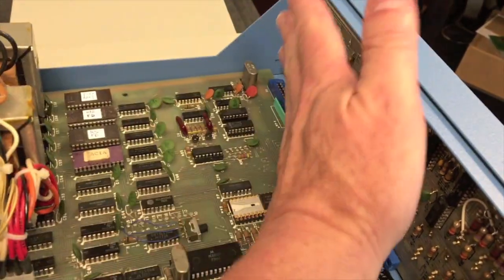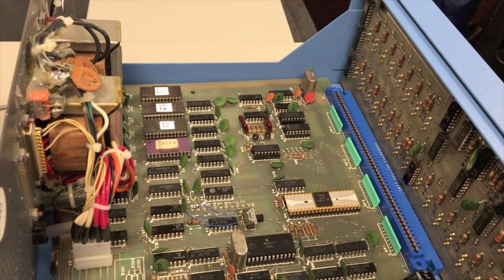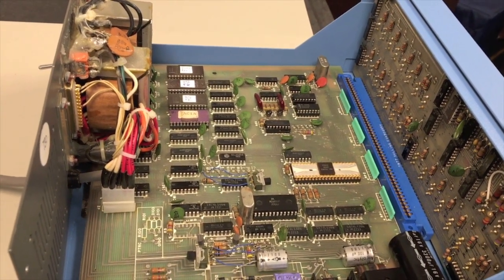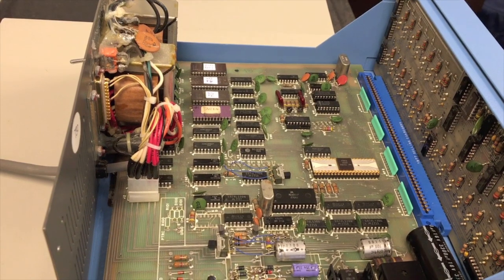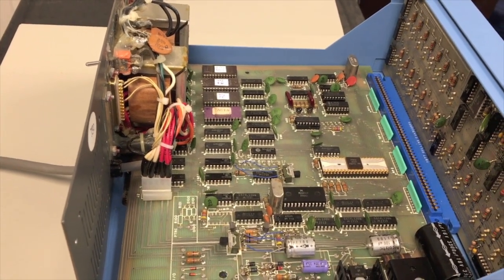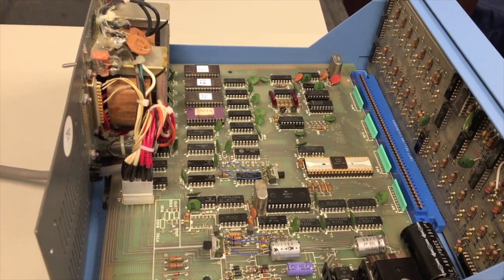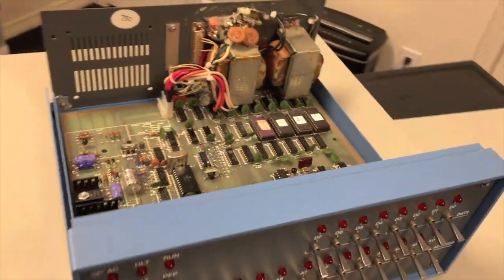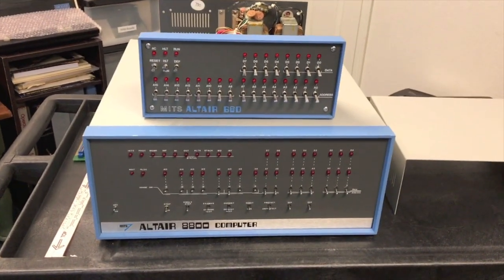So in this starting configuration we have the CPU, a serial board, 1K of RAM, and EPROM — and this was about half the price of putting that same amount of stuff inside the 8800. This does include an expansion slot for adding additional boards; a vertical riser would allow you to put up to three more boards across, and we'll look at that in another video. Interestingly, if you start with the four boards that make it equivalent to this 680, you can only add another three or four boards to the 8800 as well, because the power supply is maxed out. When they came out with the 8800b, they put in a much stronger power supply and an 18-slot motherboard, so the 8800b took full advantage of its much larger cabinet.